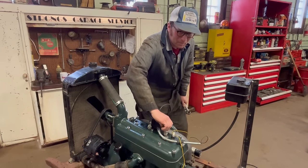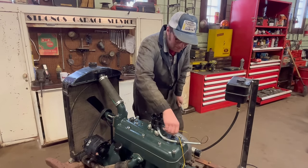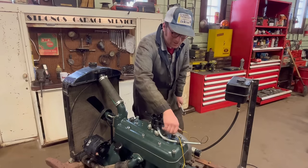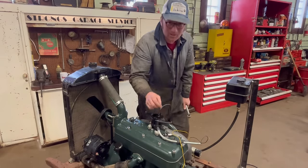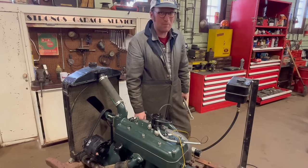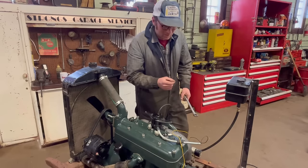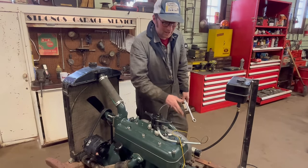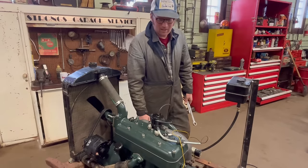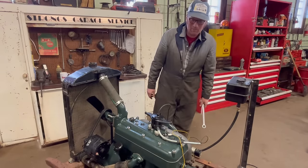And the oil pump itself, fully rebuilt and B model specific. So if you're getting into this kind of stuff, you have to be aware there's probably 5 different oil pumps that a Model A had, and the B model is different. So different shaft sizes. The rebuild kits are all for A's, so we had to machine down the shaft to allow adequate flow for this pressure main oiled B model.